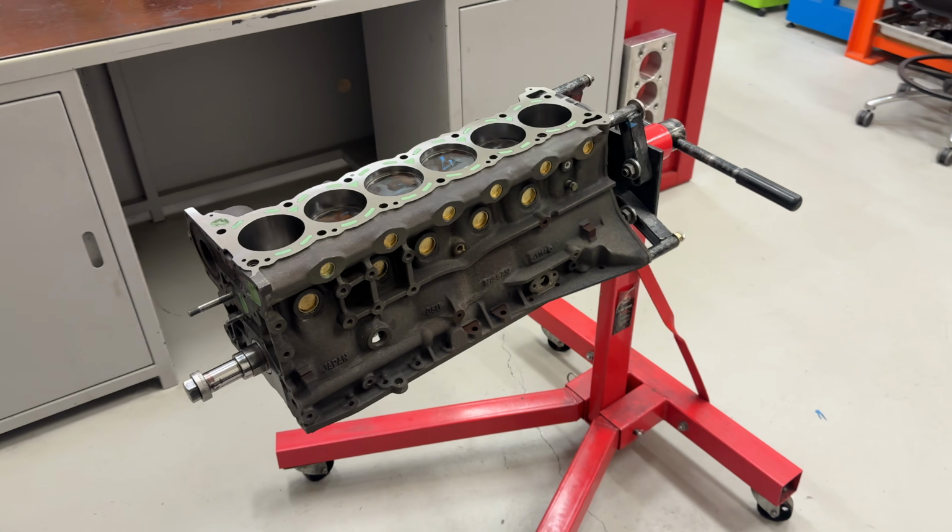This is taking me so long. Anyway, let's get it done. Oh, short block is now done. I had a rather large amount of boo-boos. I also managed to break this sucker. Turns out in the factory position, these hit the pistons on the Marley pistons, however you want to say that. Marley's easier. But anyway, you have to offset them with a washer, which is interesting.